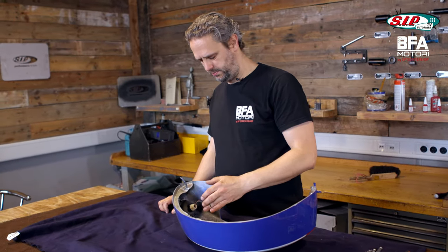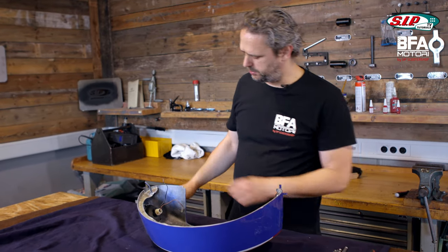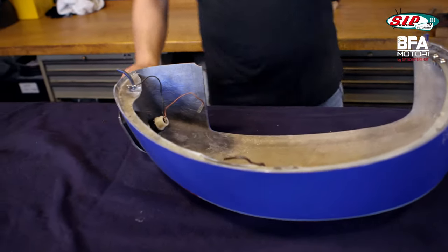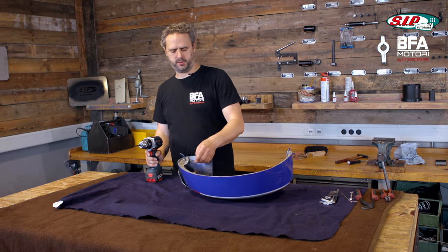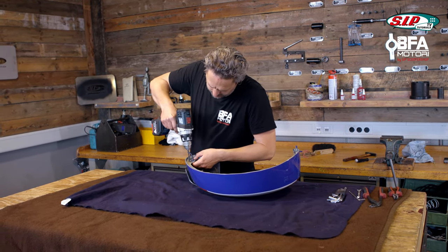Because of that, the ground cable has to be screwed on. That's really convenient with this angle because there's a nice ground cable outlet already. I'll drill a hole at this height, then I can screw the ground cable on and it's connected to the metal of the indicator again.